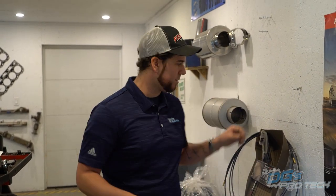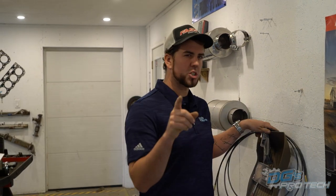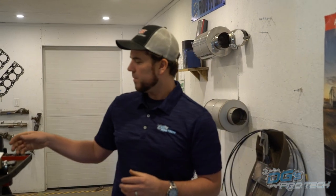How does the system work? Basically, it's like a bicycle tire. You'll have a Schrader valve mounted somewhere, and you just hook the same fitting you'd use to fill your tire right on that and up she goes. You can use the same tire gauge you use for your bicycle. Pressure ranges from a minimum of 5 PSI - to make sure the bag stays inflated - up to 100 PSI. These are really well-built belted bags.